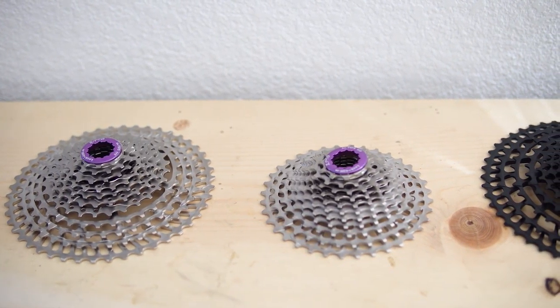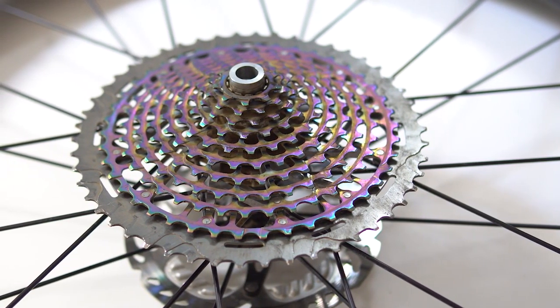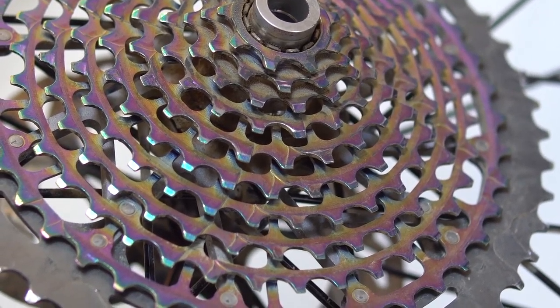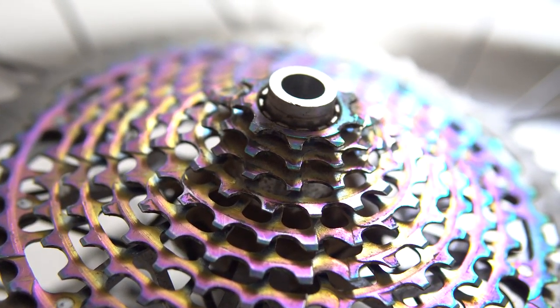Now we're getting into my cassette — the real big piece of this build that separates it from anything else I've seen. I did a lightweight cassette review on three wide-range cassettes from the company Zito. I reached out to them when they released a brand new cassette. In my research, this is the widest range 11-speed cassette available — it is a 9-to-50. This is the widest range you can physically get for an 11-speed drivetrain that I'm aware of. There are 12-speed options in the 9-50 range from E13 and other companies, and Zito makes one as well, but in 11-speed I haven't seen this before. It is an XD hub driver body style cassette, so you will need that style of hub.